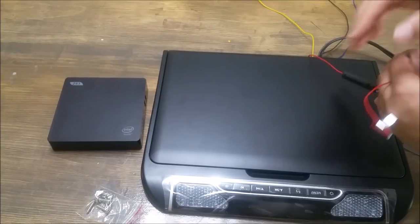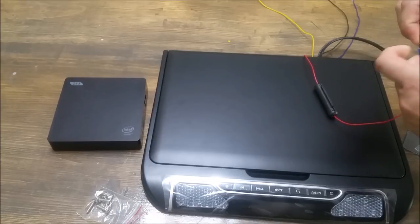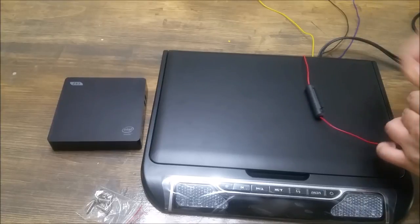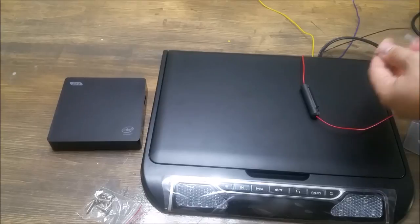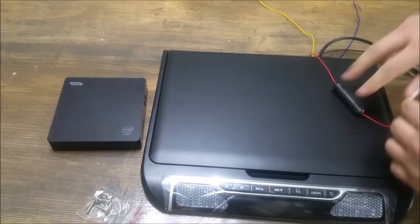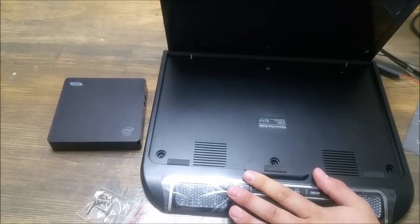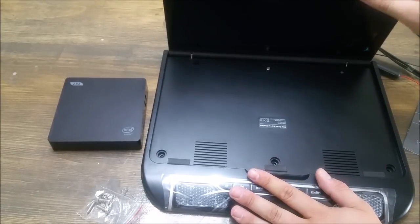I'm bench testing it here — this is just a 12-volt lead, so that's 12-volt positive, this is 12-volt negative which is the ground, and then this is the accessory. The idea is when you turn the car on you get power to an accessory and that will power it up. You can see that's actually a very strong magnet that holds it closed.